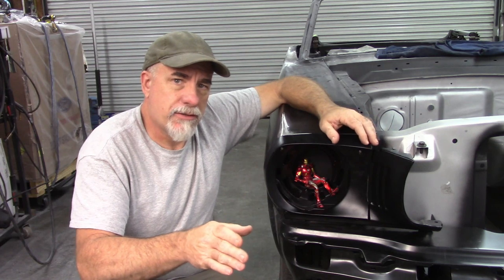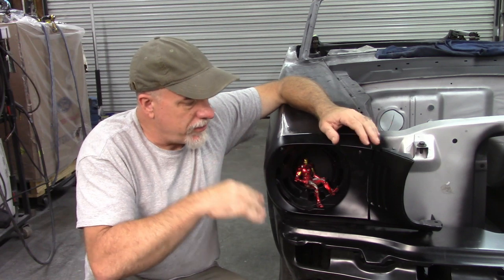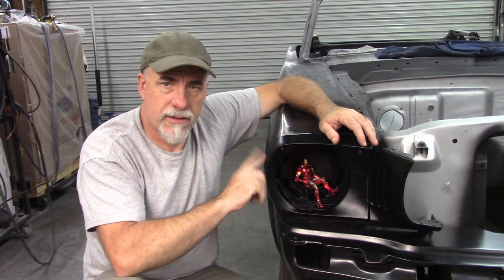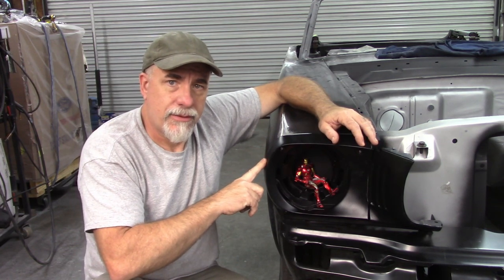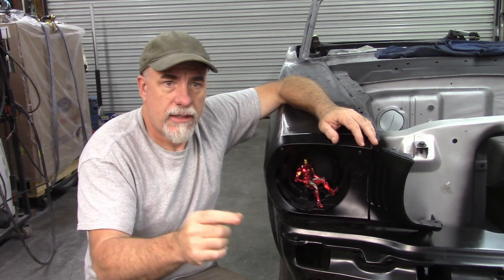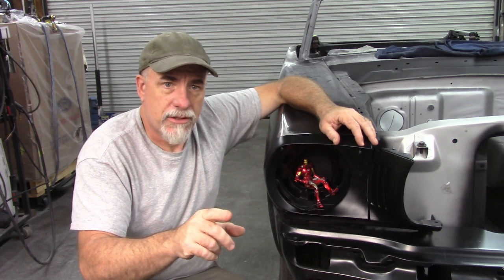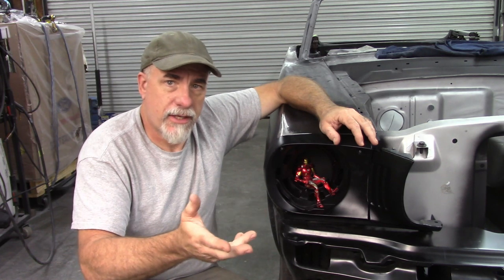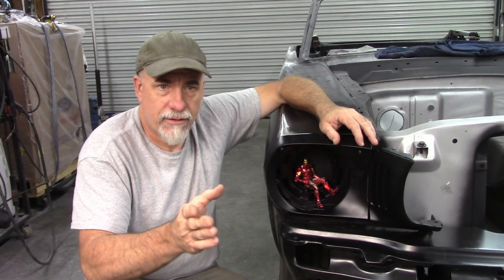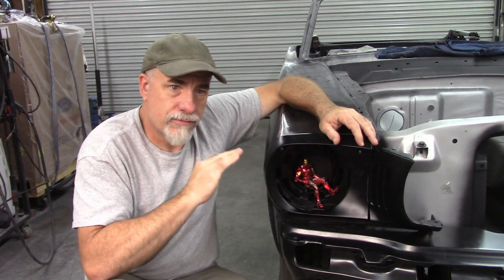I'm not sure what the next video is going to be. As I said, I still have the other side to finish, and I will do some more fine tuning of a little bit of the sheet metal here and there, but really nothing major. I think this is the last big hurdle that I had to get through to take care of the body. So you may have noticed I did not install the hinges. One of the hinges was bent, and so I'm working on either straightening it out or I'm going to have to get new ones. Hopefully I can get that one straight and get it working, because those appear to be factory hinges, so I'd like to save those. So that's why I did not put the hinges on or the hood.